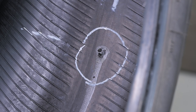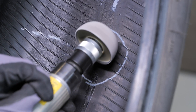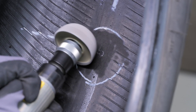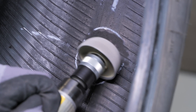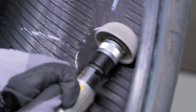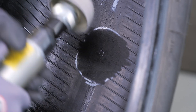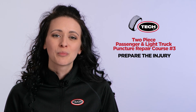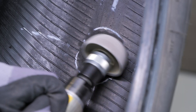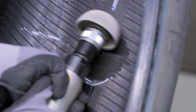This line will serve as a guide for mechanical buffing of the inner liner. Next, mechanically buff within the marked area using a low RPM buffer and an appropriate buffing wheel to achieve a smooth even buff texture. Do not exceed 5,000 RPM. If the speed of the tool exceeds 5,000 RPM, scorching of the rubber surface will occur, which will greatly reduce the adhesion of the repair unit to the inner liner. Buff the area around the stem first, then buff the rest of the area to a number one or number two texture. Mechanical buffing ensures proper adhesion of the repair unit to the inner liner by creating a clean textured surface. Be sure to run the buffing wheel from side to side across the inner liner, as this will prevent cutting grooves into the inner liner and promotes better adhesion.